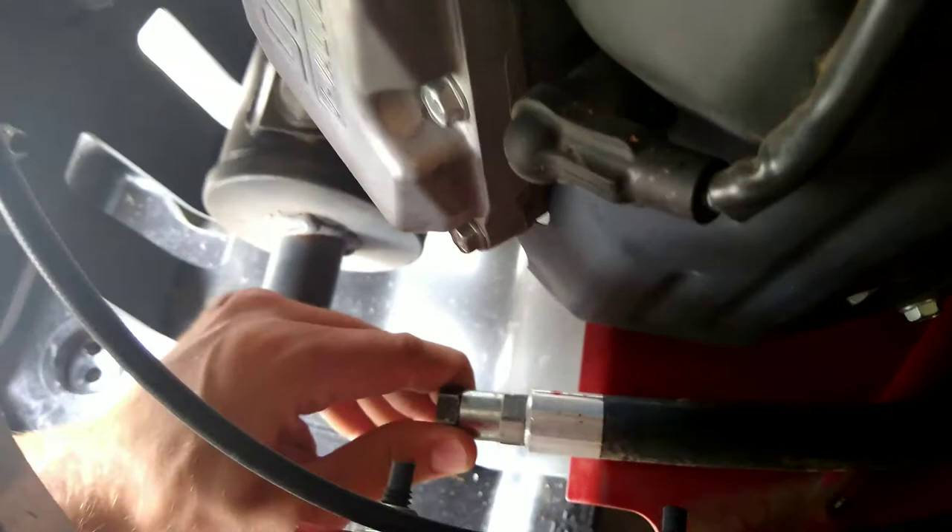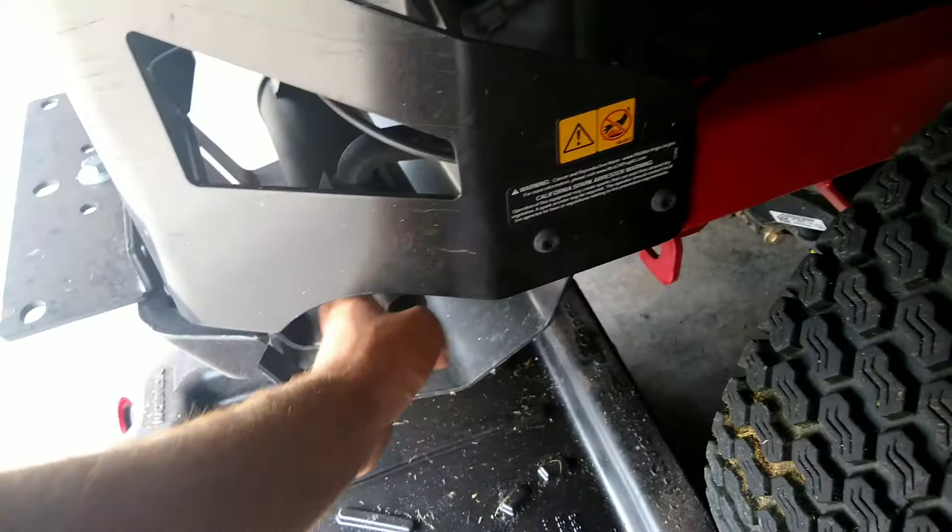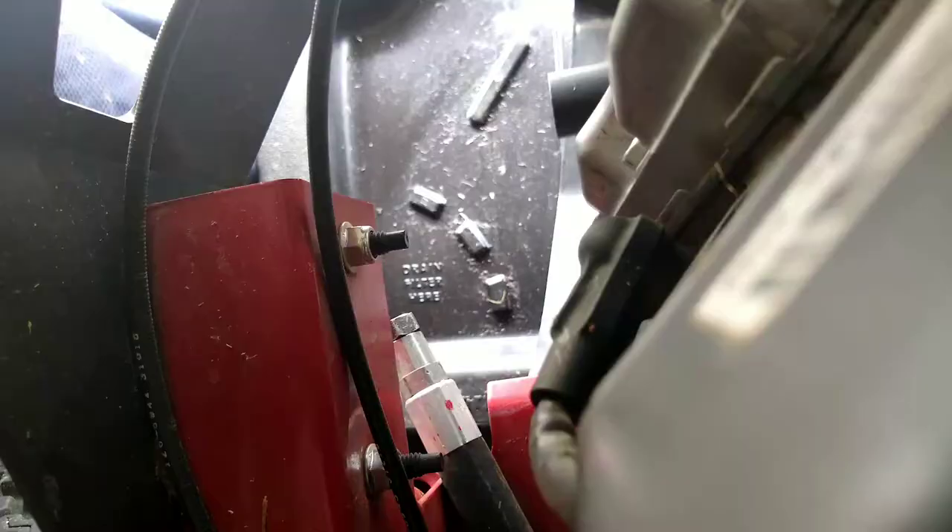After you have your oil pan set up — and for those of you that might not know where it is — if you look at the motor you will see where the oil fill is. You'll see your oil filter and you should have a nice little hose that comes off. That's where you want to set your oil pan up. You're going to take this hose and use your 2 adjustable wrenches — grip one here and one here — because that is a bolt you have to crack free to allow oil to drain out. One quick tip: make sure your motor is warmed up enough so you're not going to burn yourself. Check the exhaust — you should just be able to touch it without quite burning yourself, but definitely feel that it's warm. That's how you know the engine is at the right temperature to drain the oil easily and get all the debris out.